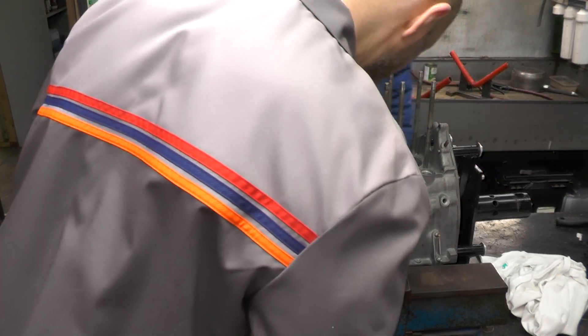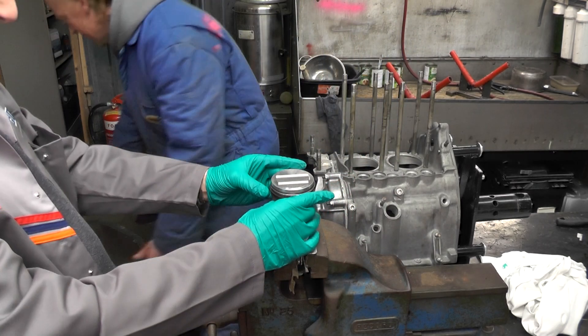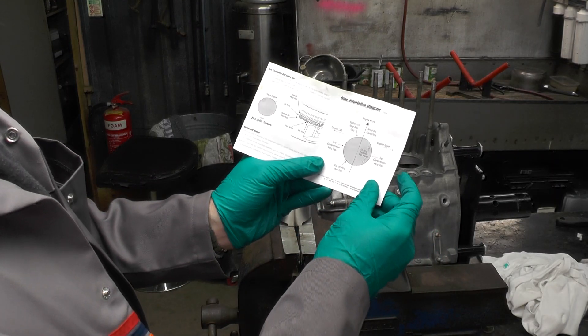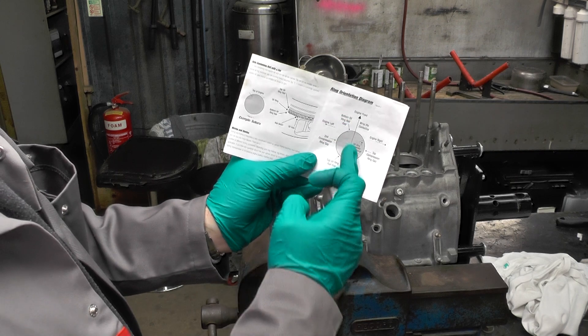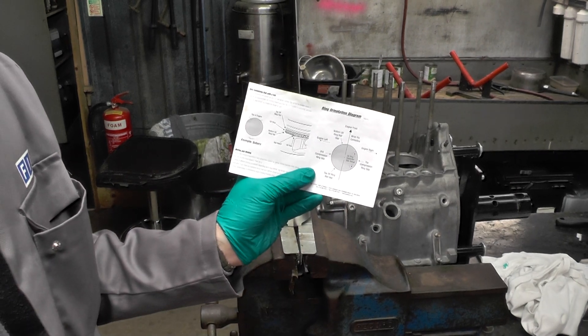It's hard to do — by the time you start pushing it down it's like they're all over the shop. So we're going top compression ring this side, second compression ring that side, and oil ring kind of there. Let's just see — make sure you can see this.